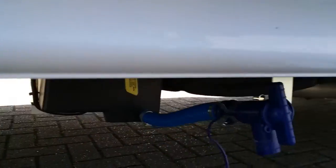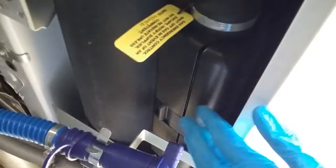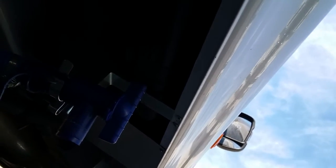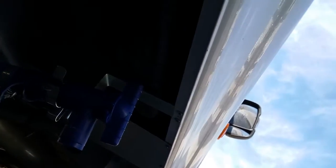Emergency gas control just here — if we go underneath, you'll see that the gas tank sits along here and then we have the front of it just here. By pulling this lever, this front will drop out, and then behind there is a brass tap, no different than what you would find on a propane bottle. You can turn this to isolate the gas.